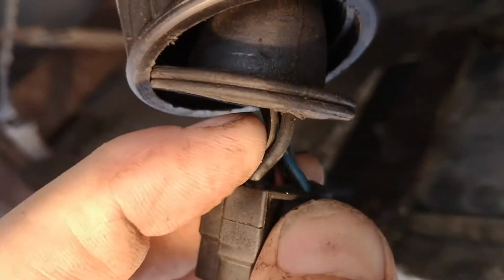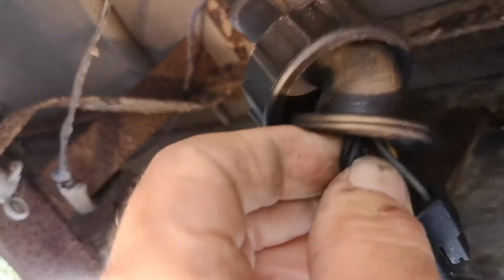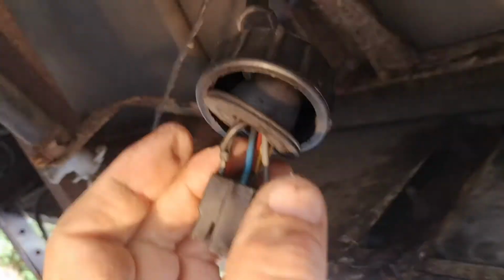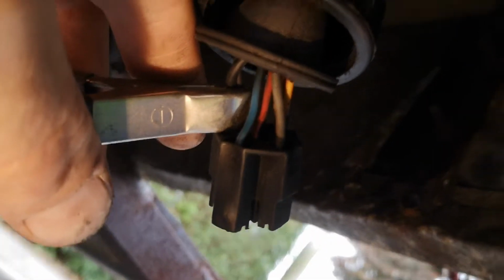So the twin black wires there are ground, or supposed ground. So what I'll do is liberate that from the connector, and we'll try and clip onto that and see if that is actually. So we've got a good ground as far as that connector, so it is this connector block that's causing the problem. There we go, that's just me. Right, so we'll get this sorted, hopefully get it back together. Happy days.